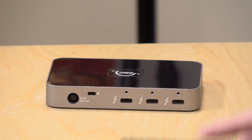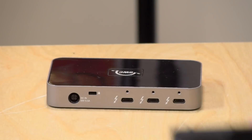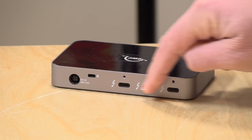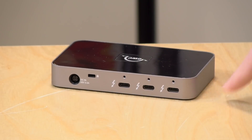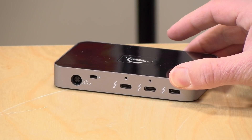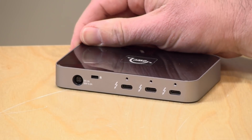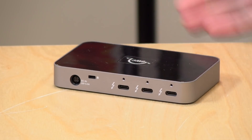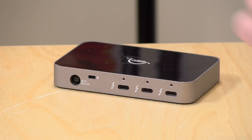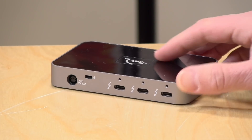The dock itself is pretty small, but the power supply that comes with it is rather large — it needs to be because it's providing 60 watts to the computer plus enough power for all the ports. Each port can supply enough power for bus-powered devices, which isn't always the case when daisy chaining. OWC says this dock is useful precisely because instead of a big daisy chain, you can connect each device individually to the hub and disconnect or reconnect them at will without breaking Thunderbolt chains.